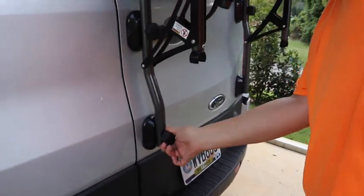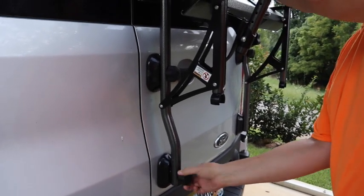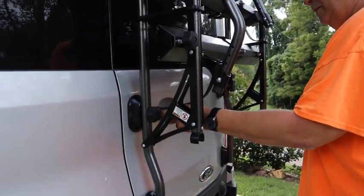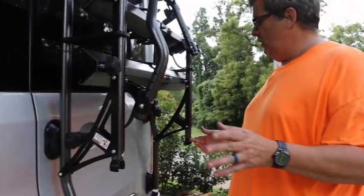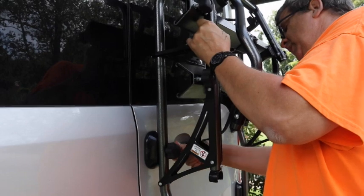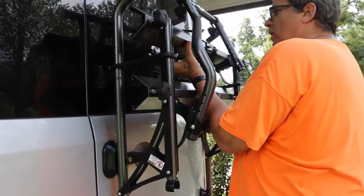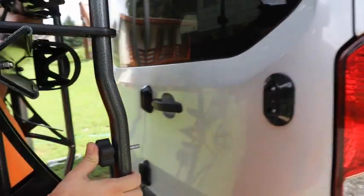I take the bottom ones off first, because if you take the top ones off first — see, when you take the bottom ones off, the rack's not going to do anything because it's going to try to pivot down here but this is holding it up there. If the top ones were off and the bottom was still there, it could pivot and bust something. So now here's the tougher part because I'm going to take off the two that hold it. I like to take this one off first because of the clearance right here. I hold it with my left hand and take this out, then lay it down. Now I've got to make sure I support the rack because it will come off. I take out the other one, and I don't remove it all the way from the rack — I just remove it from the door vent and step back with it like that.